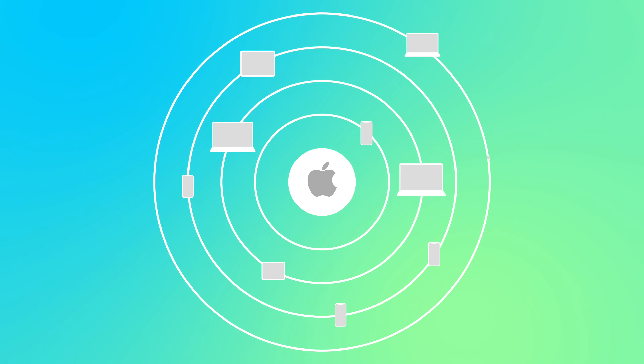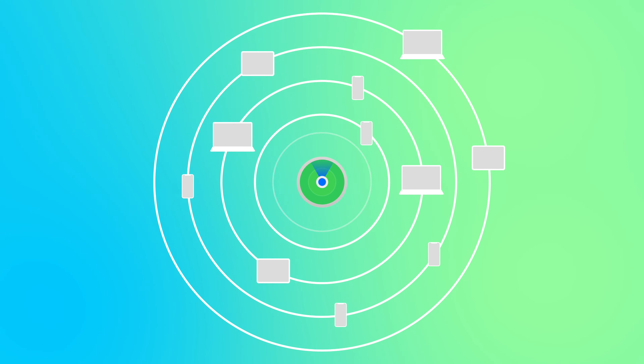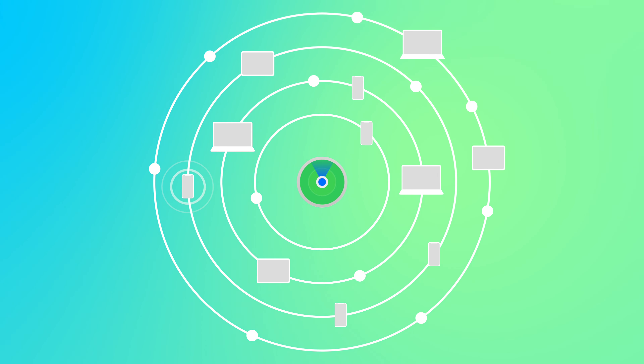So how do they work and what is the Find My network? Apple has hundreds of millions — actually closer to a billion — active devices, and all of these iPhones, iPads and Macs all feed into and expand the Find My network. You can already use this to find your lost iPhone, which has GPS, or since iOS 13 your lost phone will also broadcast a Bluetooth signal even when switched off, which other devices within range can pick up on and relay their approximate location from their own GPS back to your iCloud account so that you can find it again. AirTags don't have GPS as that just wouldn't be power efficient with current tech for something so small, but they do have Bluetooth low energy, so they rely on all of those other iOS and Mac devices to relay their location back to you when you get separated from your AirTag.